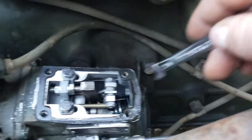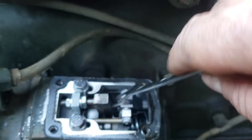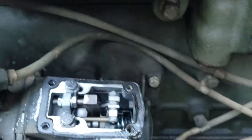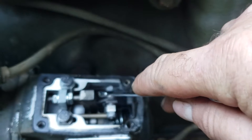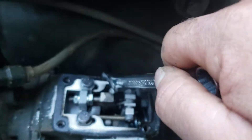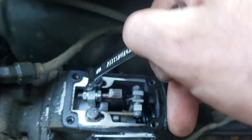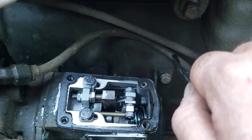Across the entire range, you can still — just like on the other pumps — turn your smoke cam up right here by loosening this and turning this up, pointing the finger up a few degrees. That will give you more boost on your high end without raising your main fuel. But if you just want to turn it up all the way across the band, you're pulling this screw towards the front of the motor — loosen this one, tighten this one — and that's as simple as that.